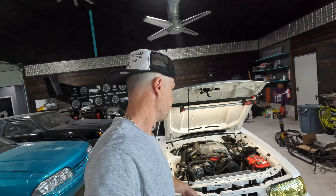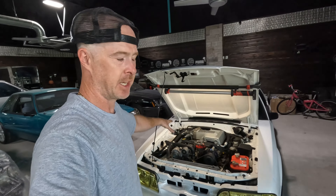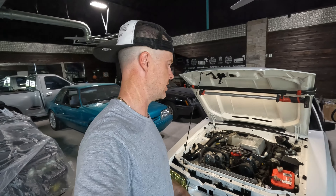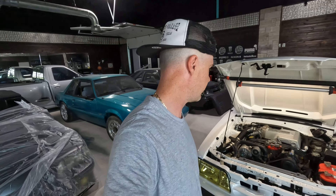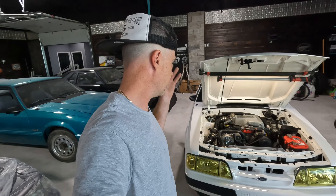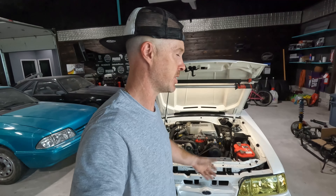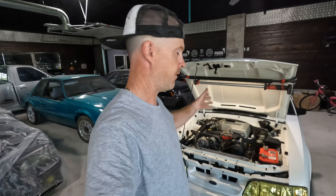There's a nice little cinematic showing you guys all the little nooks and crannies that I managed to get — and some that I wasn't able to get. It's hard, even with a rattle can, to get into every last spot, but otherwise this thing looks a hundred times better than it did before. We kind of preserved the top sides of the fenders, making sure that no more peeling, no more fading, none of that stuff will happen. Got our nice painted up hardware, everything is aligned, everything is working, everything is great. Tidied up things with a little bit of a wire tuck — call it a poor man's wire tuck — but you still have access to everything instead of having to get underneath your inner fenders to access your starter solenoid and everything else. There it is, the final product.